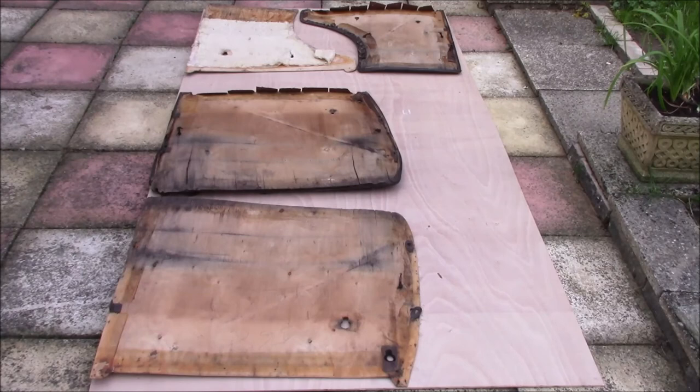Because both sets of cards — left and right — are just mirrored, and because plywood is a mirrored material, you don't need to worry about which side it's facing. You can, as with the smaller door cards for the rear, just reverse them if they fit better. So wastage is fairly minimum on this board, which is what you want. This will allow you to get all of your pattern pieces cut out and sorted out. I'll be using the two door cards I've already stripped down — the ones with the least amount of water damage — to provide the templates. That way I shouldn't have to do much reshaping and trimming. The next stage is a bit boring: all you do is draw around your pattern pieces, mark where any screw holes and fixing holes need to be, and then just cut it out with your jigsaw. And then you're done.